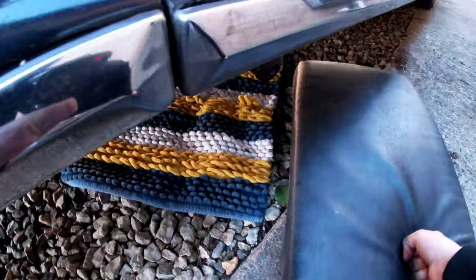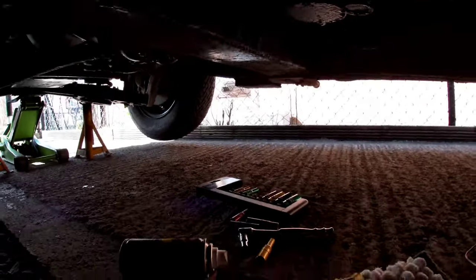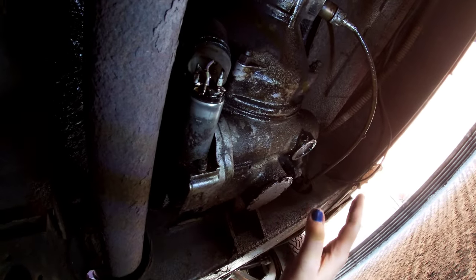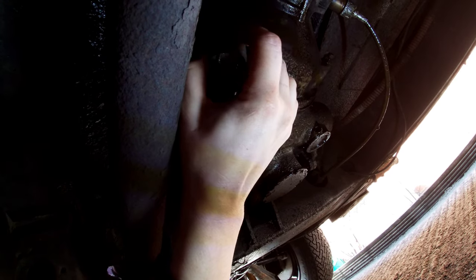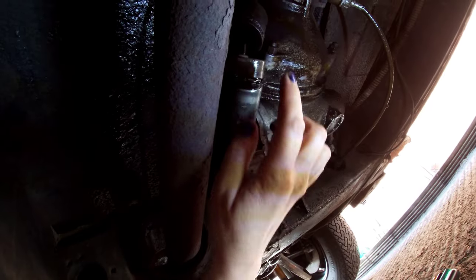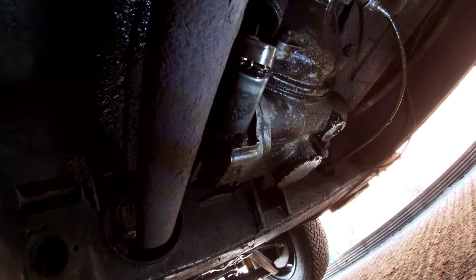I access the car under here - I haven't really jacked the car up far enough but I managed to creep under here. I've obviously got an oil leak going on, and I think what's happened is oil has got into the solenoid and contaminated it. You'll see there's the cylinder here - this is the solenoid and it'll have this big Lucas rubber boot on it. If you take the Lucas rubber boot off you then see this plastic cap.